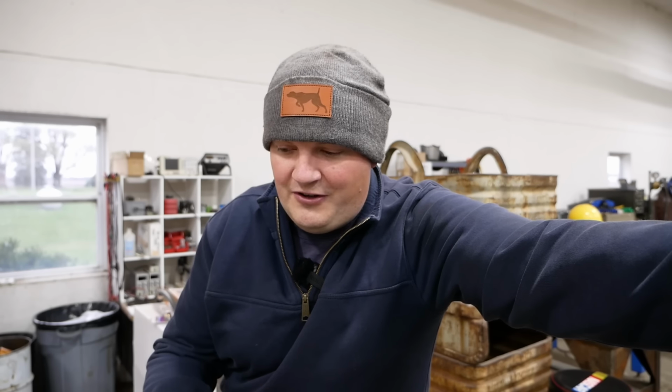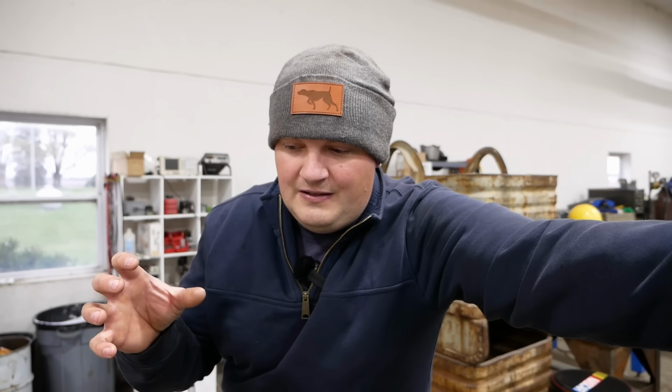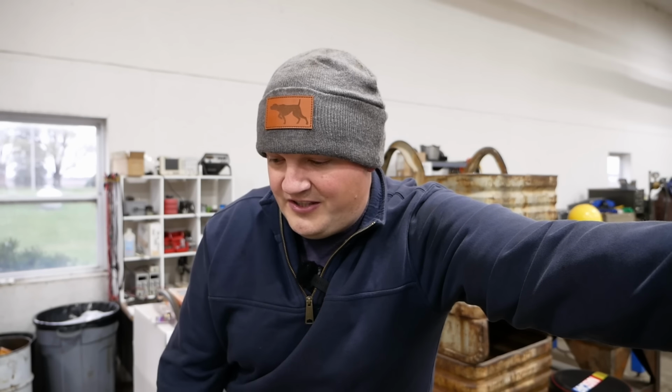It would have been less, but when you're dealing with junkyard parts, you just never know what you're going to get. If that axle had been a little bit less mangled, and we could have reused the dust shields and not had to pull the hubs off, it would have saved me probably 2, maybe 3 hours worth of work going through those hubs and replacing the wheel seals and all that stuff. But that's how the cookie crumbles. No big deal. Now he's got new wheel seals. Don't have to worry about that. We've checked the bearings. We know that they're good. Plus he gets to use his original hubs, which are, in my opinion, in better condition. So yeah, all's well that ends well, I guess.